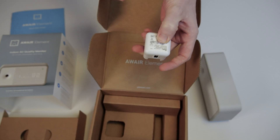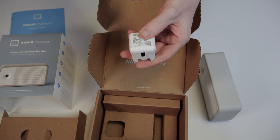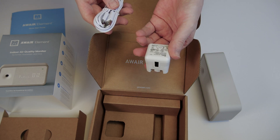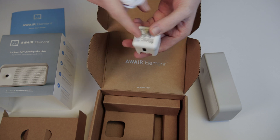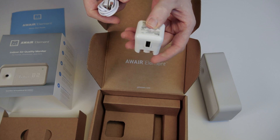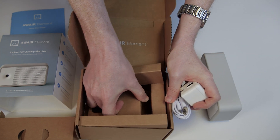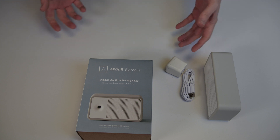The charger is pretty much just an adapter from your electric socket to USB, so you can use the USB Type-C charging wire. It has a power output of 5 volts and 2 amperes. You could technically use an adapter with less or more amperage — more would be better because the device only uses what it needs. If it has 5 volts but only 0.5 amperes, there's a chance the device will not work properly because the adapter wouldn't provide enough power. So if you order from the US, look for a different adapter with the same or ideally higher amperage, or get an adapter to plug the US plug into a European socket.